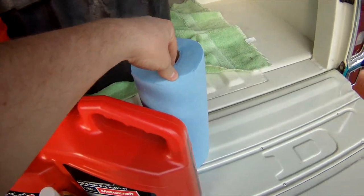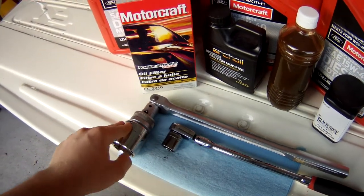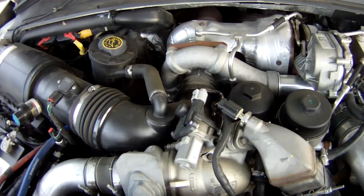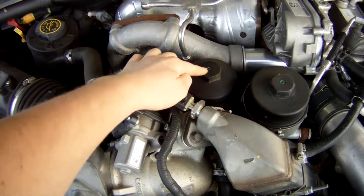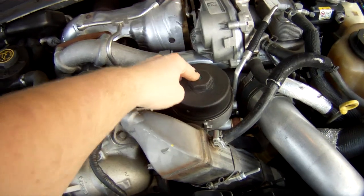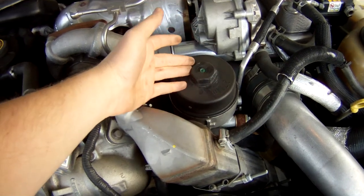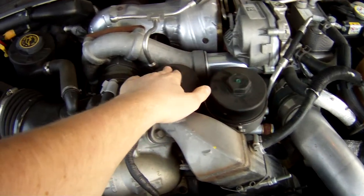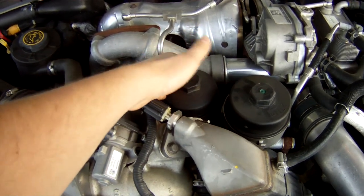Make sure that you have plenty of paper towels ready to go. You're going to need a 36mm socket for the oil filter cap and a 19mm socket for your drain plug. Before you do anything else when changing your oil on one of these Super Duties, you're going to want to pop open the oil filter cap and let it come up. Dead center of the truck, the cap all the way to the left is your oil filter cap — this is going to release a quart of dirty oil down into the oil pan.